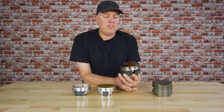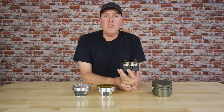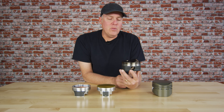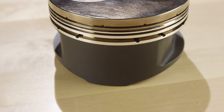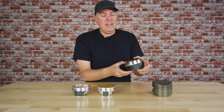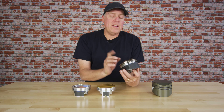Now let's look at my very custom piston for a 347 cubic inch small block Chevy that makes about 1,100 to 1,200 horsepower with a ProCharger, and needs to run wide open throttle for more than a minute at Bonneville to go 250 or 260 miles an hour. When they knew that's what I was trying to do, they wanted to set me up with a couple of things. First is the Tough Skirt — a dry film coating similar to what you've seen on the SRP piston, but a completely different process. This one is actually sprayed on across the entire skirt, designed to protect me when I run out of oil at like 8,000 RPM and 200 miles an hour to prevent scuffing.